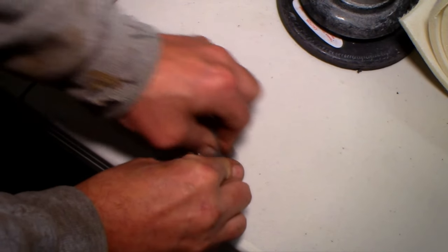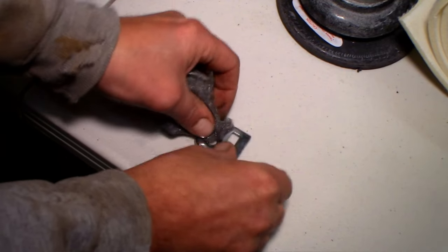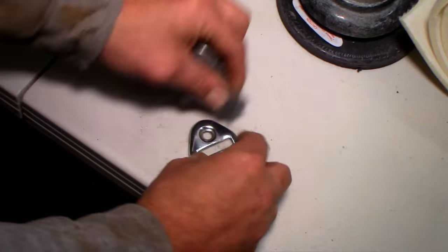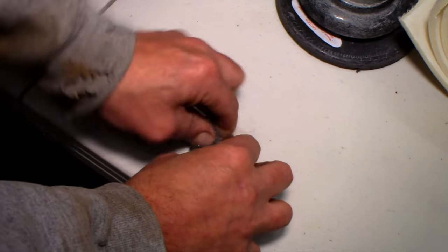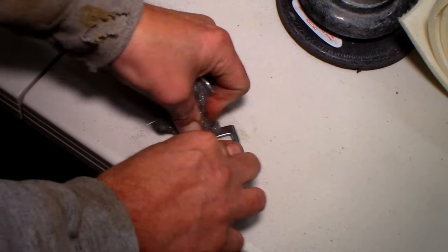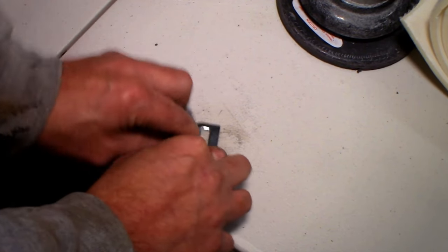It is kind of funny, though. You can take the nastiest looking chrome, and as long as it's not rusty or pitted, just a little steel wool, and it looks brand new again. Then keep it nice and new. Just either wax it or use that Gibbs penetrating oil or WD-40 or something on it. Keep it oiled up. Should stay pretty rust free. If you keep after it, this isn't too bad. Let's take a look.